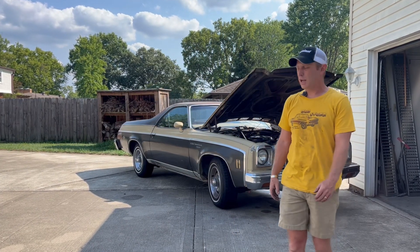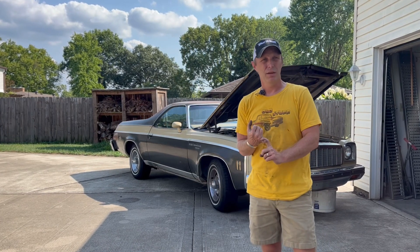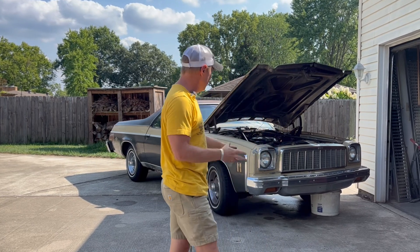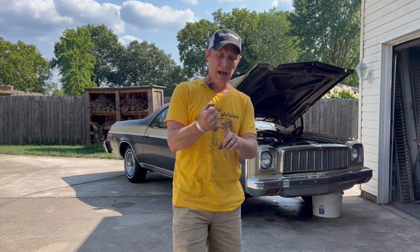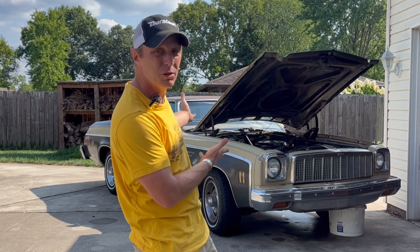Welcome back to the channel. Today we're finally getting to work on the 1975 El Camino. We've got a set of 305 high output cylinder heads that are going to go on it. Today is going to be the teardown — we need to know how far down in the hole the pistons are and how many cc's the dish on the pistons is, so we can order the correct thickness head gasket and not get the compression too high, so we can still run on pump gas. We're going from about factory 8:1 compression to somewhere in the neighborhood of 10. Let's get to it.